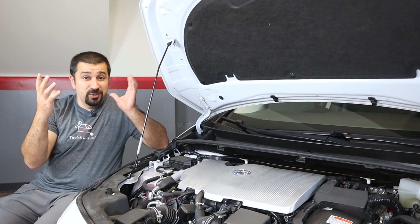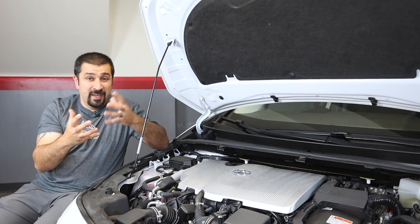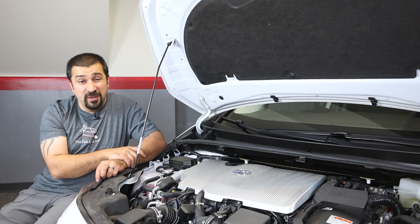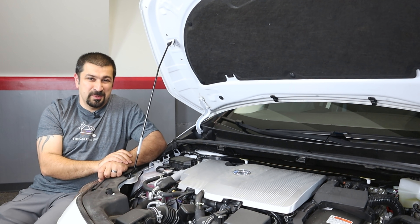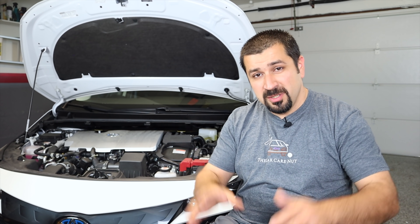But to do that, remember MG1 is connected to the engine, and if you spin it, it's going to spin the engine — that's just how they're connected in the planetary gear set. Based on viewer feedback from my previous series, we're going to show you the power flow and how the planetary works. Let's talk about the planetary gear set inside any Toyota hybrid transmission. All have a planetary gear set, and we'll focus on the plug-in hybrids, which is similar in orientation to the latest generation hybrids.